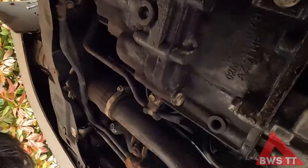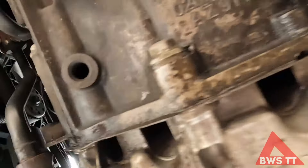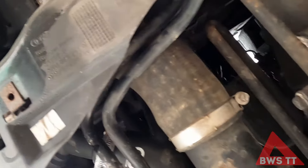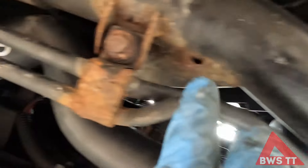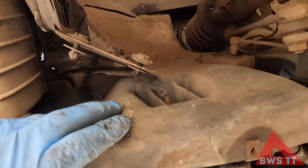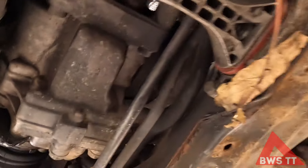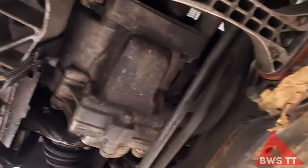Let's have a look under here. We've got a crossover pipe that needs to come off, we're going to have to undo the power steering lines, these side covers are going to have to come off, the subframe obviously has to come down, the wheels are coming off, there's the starter motor up there, we've got to undo the prop and then we have to undo the drive shafts. Yes, there's a fair bit to do. People get scared of dropping the subframe for some reason and that really confuses me. Yes, it does affect the alignment, but if you're doing anything suspension-related you really should get the alignment sorted afterwards anyway.